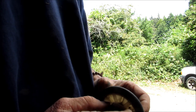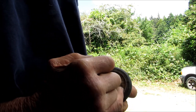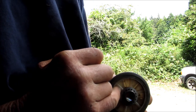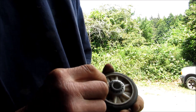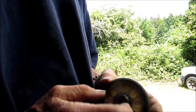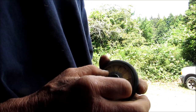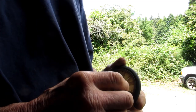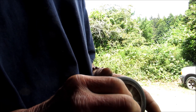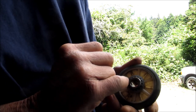What I'm going to do is put some glue or E6000, and press these clamps together. And that way this will be solid. And the thing is that this is not solid. Basically, it's rubbing against metal, against whatever, nylon or the plastic. So it'll eventually wear out quicker than normal. It's supposed to be solid here, so that it only turns on the shaft and this outer bushing.